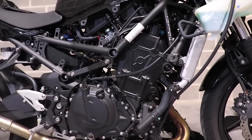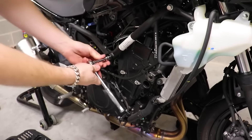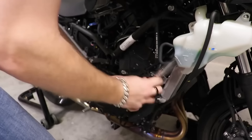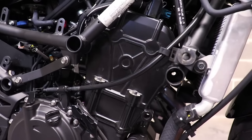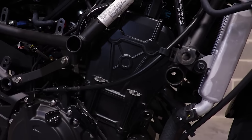The newer Ninja 400 has solved a lot of these issues, but according to Rider Forum, some people have reported problems with the gearbox. They've had a hard time shifting, reported false neutrals between 5th and 6th, and in severe cases they can't even get the bike into gear. From first-hand experience, we didn't encounter any of these issues with our giveaway Ninja 400, so it's possible that the gearbox just needs some breaking in.